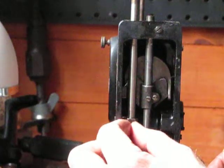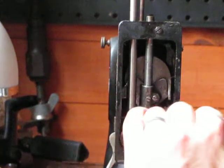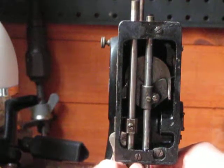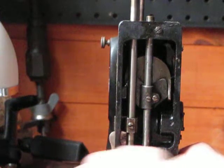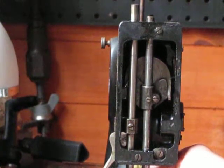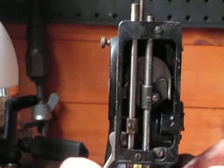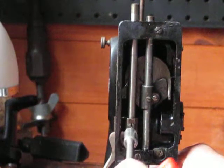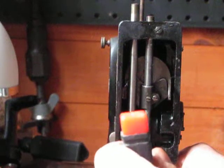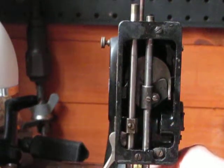And the lines on the bar I haven't removed, so I know if it's gone too far or too high. And as you can see there, got a line there and got a line there, so it's just a matter of popping that one there, making sure it's in some form of alignment for the actual presser foot itself. I just may have to move that around from time to time because that's now out of alignment. I'll just loosen it slightly and then the presser foot is straight on the actual head of the sewing machine. That's that.